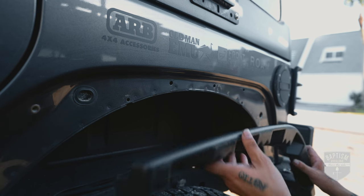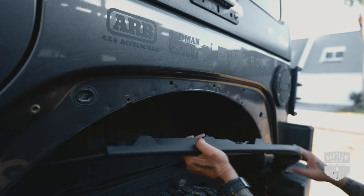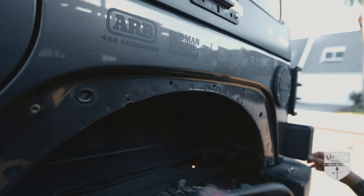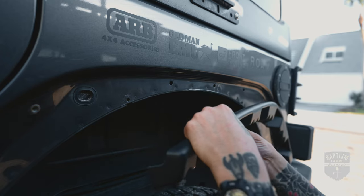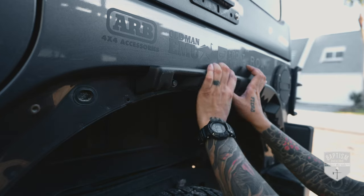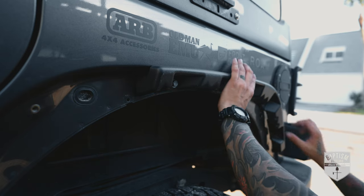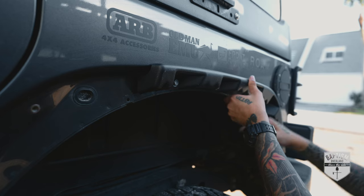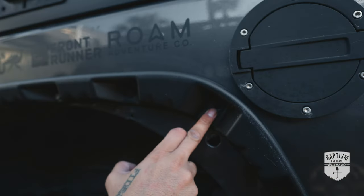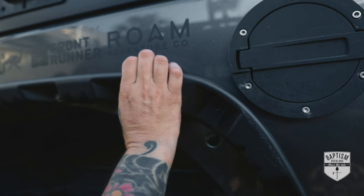Those clamps are attached — flat side on the outside, bumpy part on the inside — one, two, three, and four. The piece we're starting with is D6, which goes towards the back of the vehicle. Line up all the holes to the corresponding holes on the bracket. Use the bolts they provide: bolt, washer, put that through your bracket, slide it in, and get the bolt started in the back. For holes not accessible from the rear, Bushwacker wants you to use push pins. Over here I actually had a rivnut from my old install, which works in my favor — I can use the bolt from before, which will hold it a lot more securely.